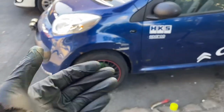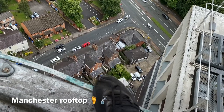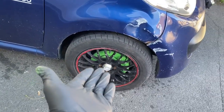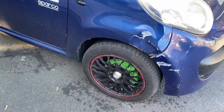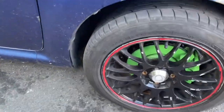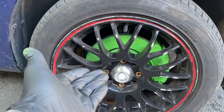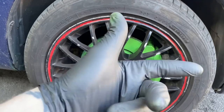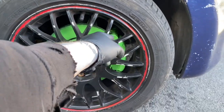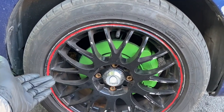I'm going to go ahead and do the other side off camera, because it's bad enough watching this once - you're not going to watch it twice. I've applied the paint even more liberally on this side on the front brake, and done the back one too. Now all I've got to do is wait for it to dry and then test drive it to make sure I actually have brakes. I'm not saying that painting the full thing without taking the caliper off is the right thing to do - I'm saying it's the easiest thing to do. If you're going to do this properly, obviously mask things up, take the caliper off, take the pads out, take all the shims out - you don't really want to be painting any of that.